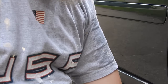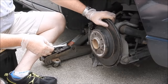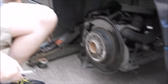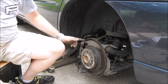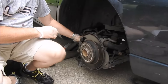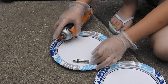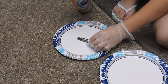Next, I need a 10mm wrench or socket. There's a retainer right here I've got to take off. Got my 10mm wrench — this needs to come off, it's really easy to loosen. Take that out and set it aside so you don't lose it. I also have to remove these — I think that's either a 15mm or a 17mm. Let me try my 15mm and find my wrench that fits.